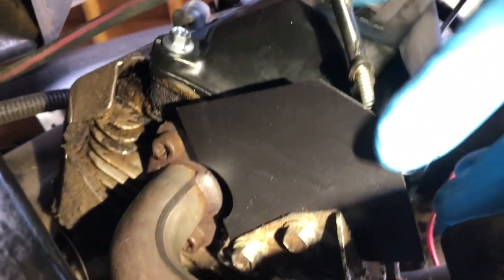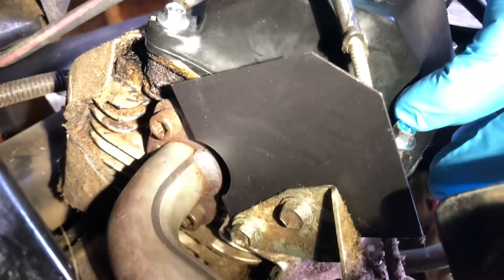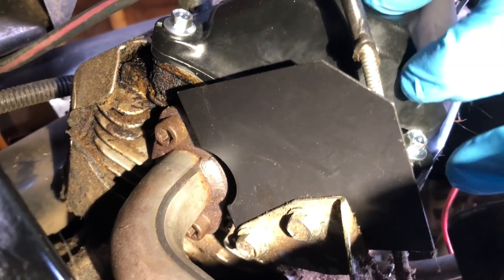Valve covers are in. The heat shield is there to help protect so it doesn't overheat and lose the gasket — that's what makes the gasket fail, and it's also what will cause that plastic valve cover to fail.